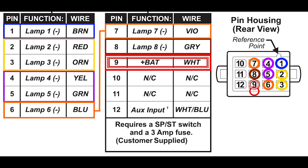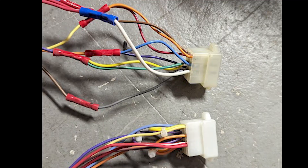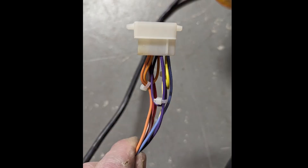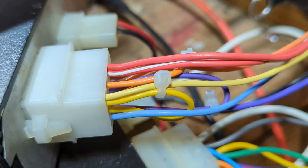This is how it broke down on the pinout of my eight-output Whelen controller. It wasn't really hard to group it. The wiring could be done like that, which is how I tested it — it's not pretty but it definitely works. Or the final product is actually pinning out a Whelen plug with the Code 3 wires, which just means you were jumpering the wires that needed two outputs. You end up with the Code 3 colors going into two outputs in three occasions, and then you're combining your two red power inputs into the one power input that the Whelen used.